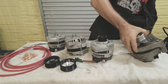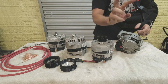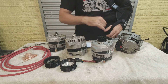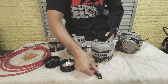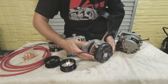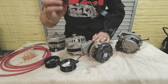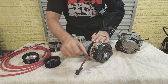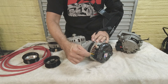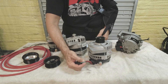The control wiring is actually pretty easy. The stock alternator has six wires — two plugs with three wires each. Two were the heavy current wires and three were smaller. One of those smaller ones was the white stator wire that just looped between the two plugs, which leaves you with just two remaining wires: a yellow and a green. The replacement alternator also comes with just a yellow and a green wire. The yellow is the key-on ignition sense wire that energizes the coils to start generating current. The green goes to the dash and illuminates the charge warning light when it's not charging.